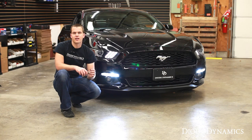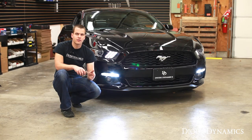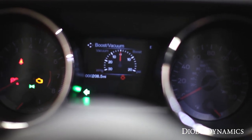With the bulbs installed on both sides, we have a nice cool white modern LED appearance. We also retain that really bright amber front turn signal with modern LED instant on and off — we didn't sacrifice turn signal brightness but still have the dual color effect. Now, you may have heard that some turn signal LED bulbs require resistors or else they blink really fast. The Ford Mustang for 2015 and up actually blinks at a constant speed, so you really don't need any resistors at all — you'll always blink at the standard rate. The only difference is inside the vehicle the indicator will have a different clicking rate, which actually sounds a little like a pony trotting.